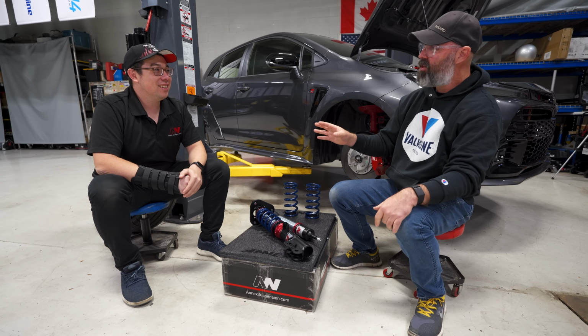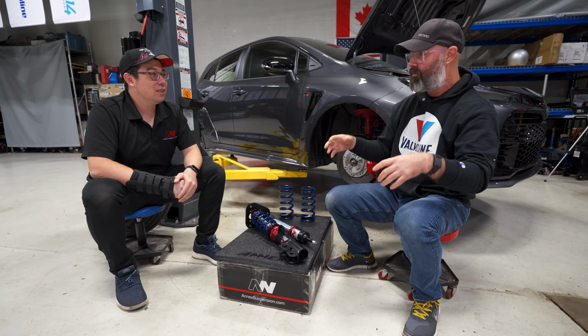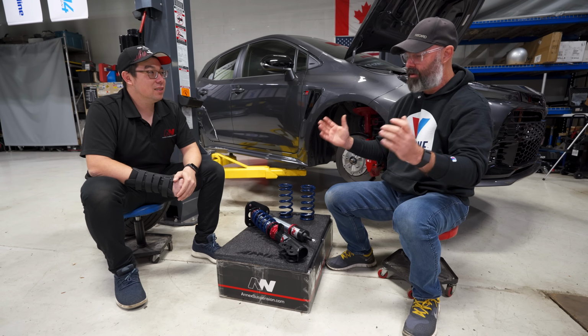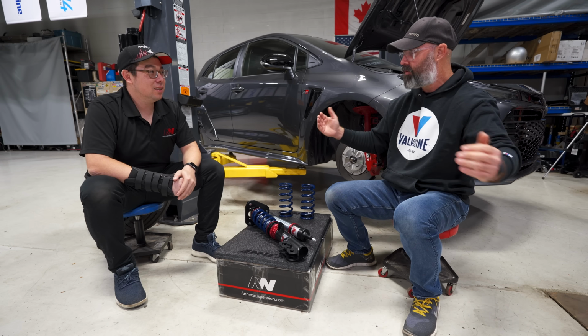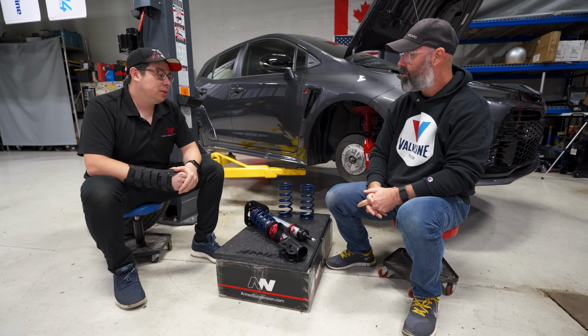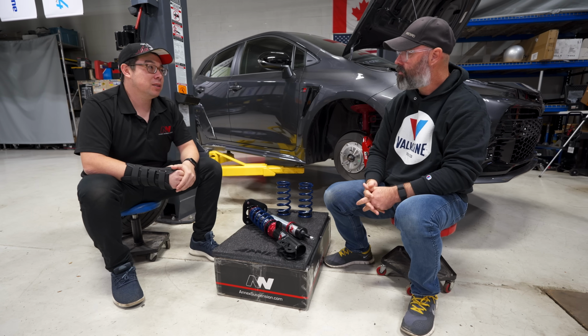Yeah. It's interesting to hear that you say there is a little bit of a dead zone at each end, because in my experience, running any damper at full stiff or full soft, it doesn't feel like it's working well. So I often start in the middle, and I tune out from there and try not to go too close to the extremes. Right. And I suppose that's probably true with most dampers. Yeah. And generally, you never will run a shock at full tight. So just don't even bother.